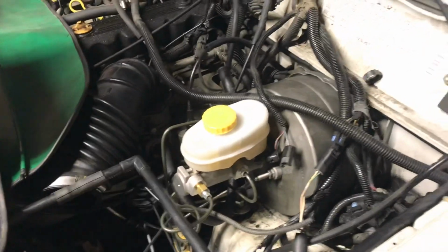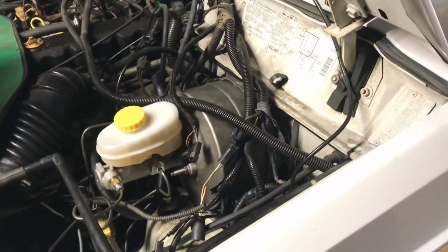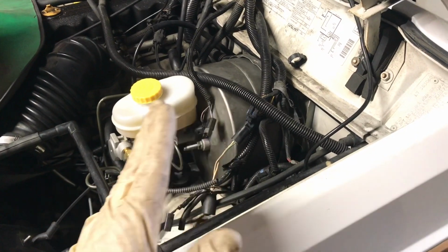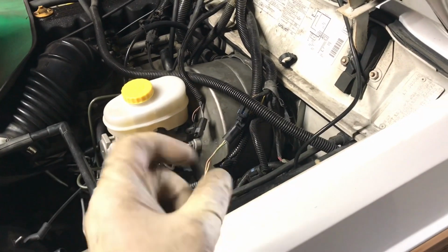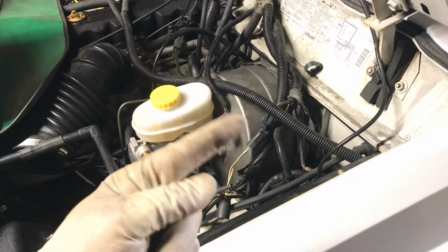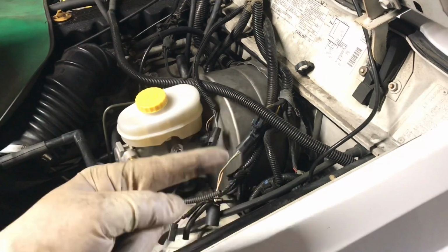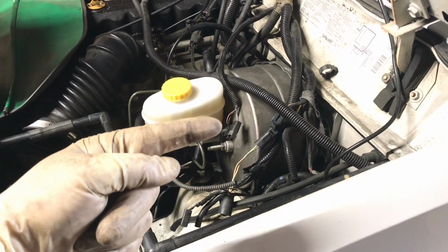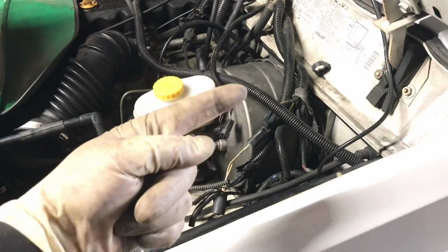I had a 1/4-inch plate in here, which brought my measurements right, but my pedal was sticking. You push down the brake, it would hang up. So the rod obviously was under tension still. And that makes sense, because there is a little bit of a difference in the angle of the push rod. Somebody mentioned on one of the posts that I read, they re-drilled a hole.